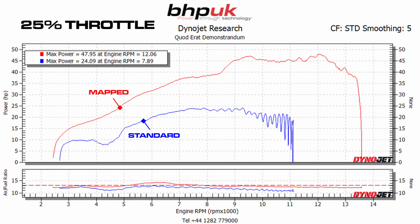The bike has had a little bit of work done to it — it's got a sports cat on it and the lambda has been deleted, which isn't always the best idea in the world, but that's how the customer brought the bike to us, so that's how we're going to set it up. Let's do what we always do: get it run up on the dyno, see what the fueling is actually doing, and get it set up to run properly.